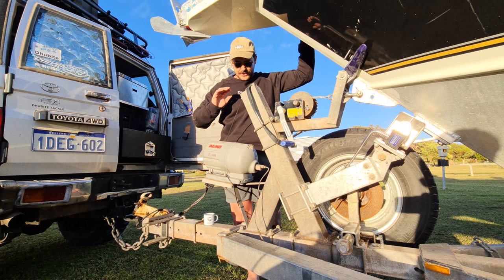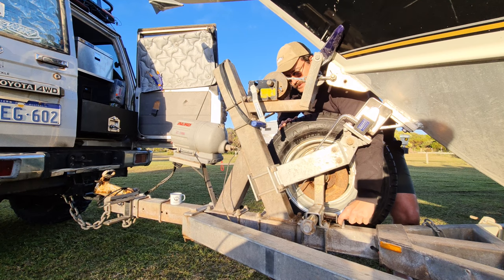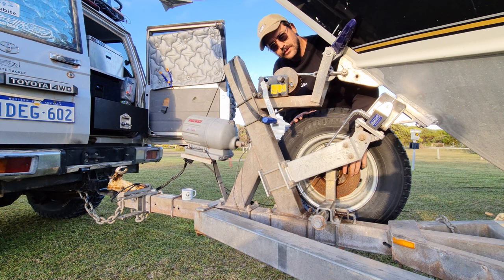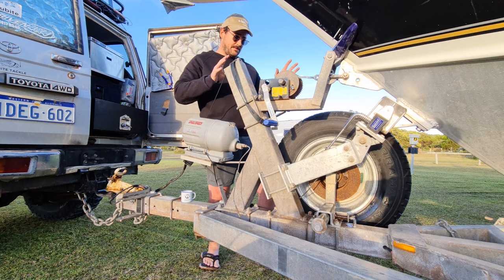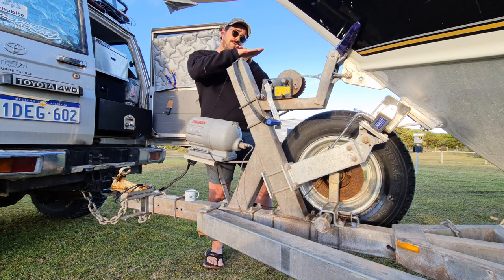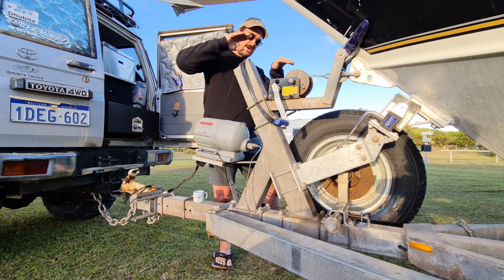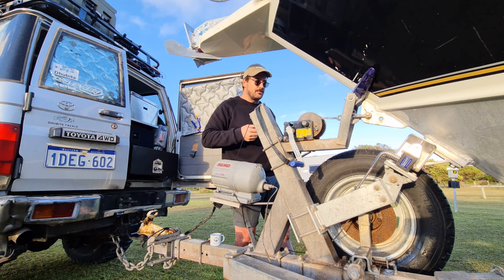What we do is completely disconnect the trailer on what a lot of people have, which is the fifth wheel or the recovery wheel. It's got a pin here — it comes out, you lift this, it'll pull out, swing around, and then this will drop beyond the floor and the trailer is rotating on this. It's also got the benefit of having a spare bearing in there, so if you do lose one on the trailer you know that one's good to go. You just drop this in — the boat's not going to be on there so you can just push it right back into the water. The main trick is never do it on a flat and never do it in the water, because even small ruts are really hard to push a trailer through by yourself. Make sure you're on a little bit of a slant, chock it with a bit of sand, then when you're ready, have your snatch set up, push it in, and pull it out with the car.